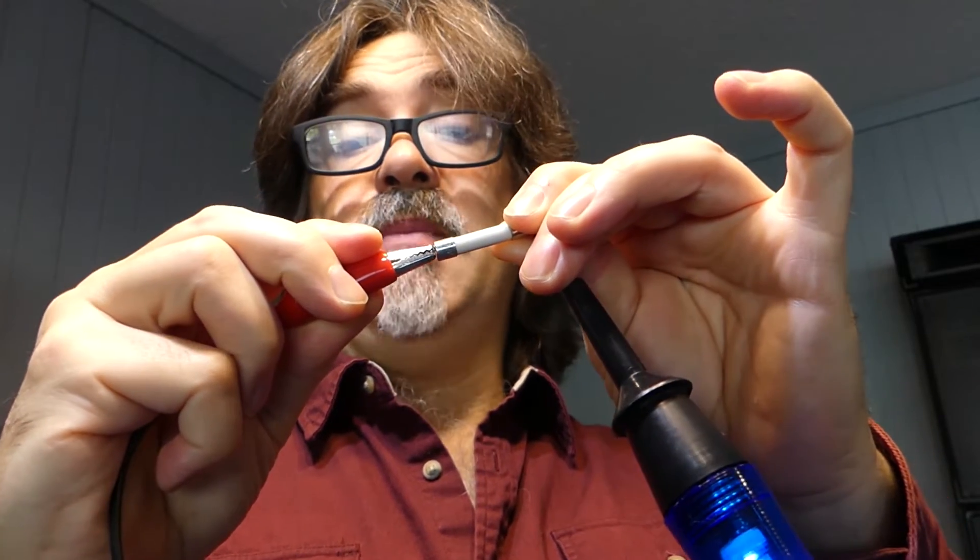So if your amplifier is not coming on and the fuse is still good, you've got another problem. If you connect the test light and it does not come on, then the fuse is bad and you need to replace it. Generally, if your amplifier blows a fuse, it'll turn on and shut off right away. A lot of times that's a blown fuse. Sometimes it'll be a fluke — I would recommend checking the fuse, replacing it, turning it back on, and seeing what happens. If it blows again using the proper fuse, you probably have a major problem. If it keeps blowing, something else is wrong.